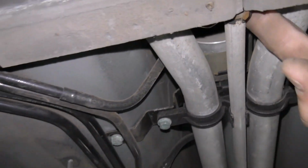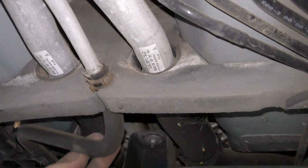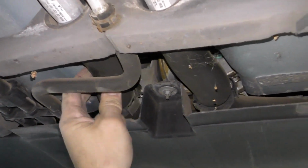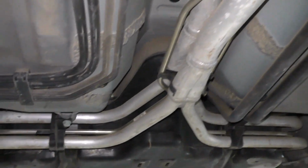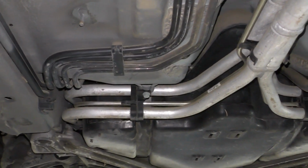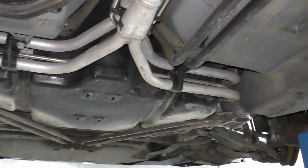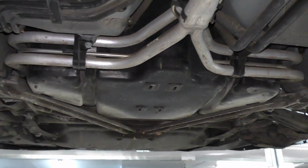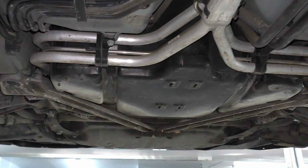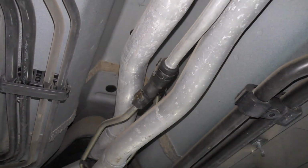What I'm looking for is things like coolant pipe corrosion around here, general hose condition, same things we did up front. You want to grab your lines, squeeze them, move them. One thing you want to be aware of, if a car's been sitting outside, there's a lot of little cavities that critters like to live in. I found everything from black widows to, at one point I had a large rat inside a car that freaked out one of my employees because its tail dragged down over his nose when he was walking around under the car. So be careful the first time. If it's been sitting outside, you can have a lot of hitchhikers that have moved in. But this is the kind of stuff that you want to look at. Any of these little hoses that could cause a failure as soon as you put it back into service.